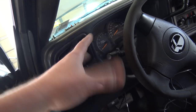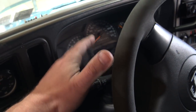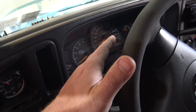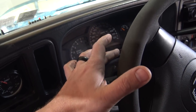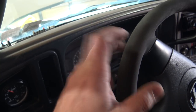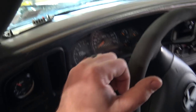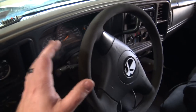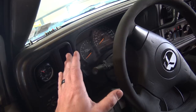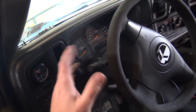This car has what's called a serial data dash — it's not CAN bus, but it gets a lot of information. A lot of these cars have very simple wiring and get tach, speedometer, fuel, and coolant through the ECU. The oil pressure sensor goes right to the block. A later model like the E38 — Corvette and stuff like that — the oil pressure goes into the ECU and then the ECU tells the dash what it is over CAN bus. You would lose most of the functionality of the dash if you ripped everything out. Sometimes people just put the Holley 7-inch or the Pro dash in and then wire the fuel gauge and everything else, but it's kind of neat to just keep all that.